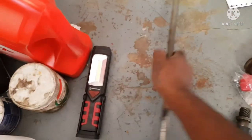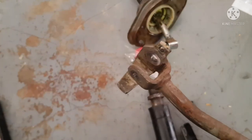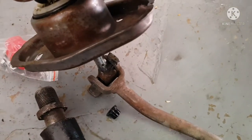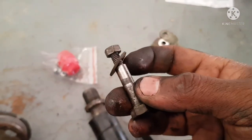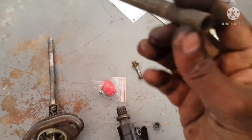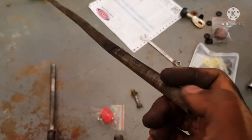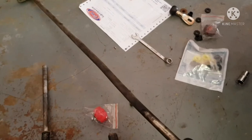And speaking of the shaft — I took the shaft out as well guys. So there's the shaft. As you guys can see, the shaft actually fits in there. The bushings are in there. And then you've got a special nut. The spline is what I was speaking about — it's the spline here guys. So by moving this in and out, or left and right, you adjust the position of your gear lever. This is the only adjustment that you should be making. Hope this helped you guys. Thanks, keep well, cheers, bye.